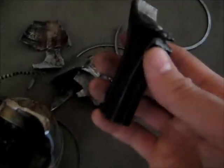And this happened at about, I don't know, probably 3,000 or 4,000 RPM the engine was doing, because I was in the car when this happened. Just clunk, clunk, clunk, clunk, and it was a big jolt, and that's it. But the engine still kept on. You can see here, the valves have been hitting. That's probably from the intake valve, and that's from the exhaust valve. Because when the bearing spins, there's a bit of play, a lash, whatever you call it, in the cylinder, and it goes up a little higher, and then the valves end up hitting. So yeah. Not a good idea to run an engine with spun bearings.